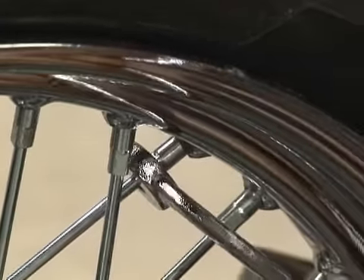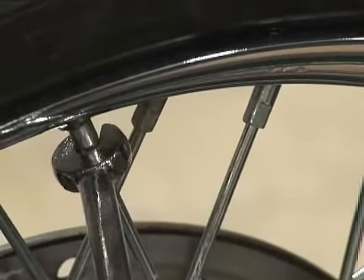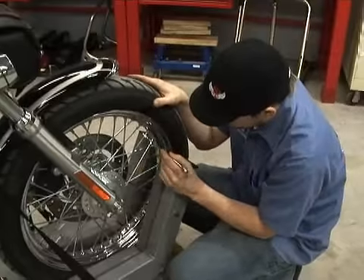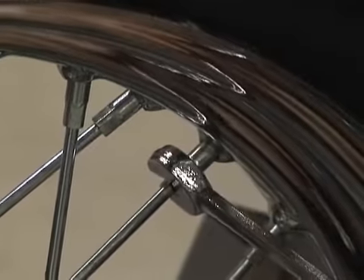Number ten: wheel spokes — check for loose spokes. Put the bike on a lift and rotate the wheel using an appropriate spoke wrench. This is also a good time to inspect the rim for excess run out. If you're really a techie, mount a dial indicator on the bike close to the rim; otherwise, use a pointer such as an old coat hanger anchored to something solid on the frame, swingarm, or front end. Tighten only the loosest spokes, no more than a quarter turn per adjustment. If you're not familiar with this procedure, ask an experienced buddy for help or periodically have it done by a professional, as it is easy to get a rim extremely out of true. Over-tightening spokes will cause unwanted offset in the wheel, not to mention creating a bind on other spokes. When new, spokes find their sweet spot as the spoke ends and nipples seat into the hub and rim, allowing spokes to loosen. After the break-in and a good spoke tightening and truing process, they continue to stretch, so spoke tightening and truing should be done yearly or every 10,000 miles.